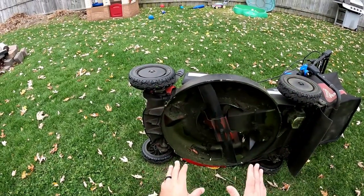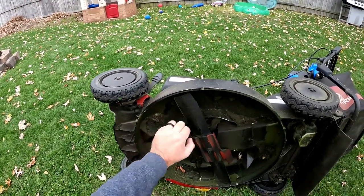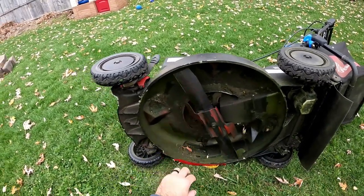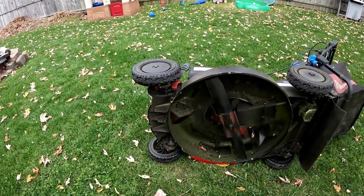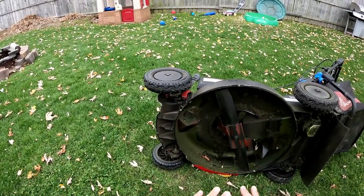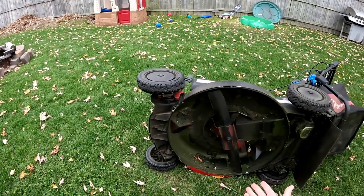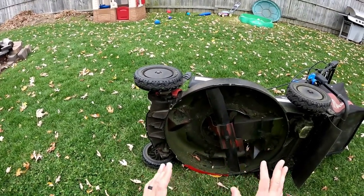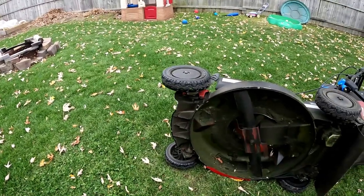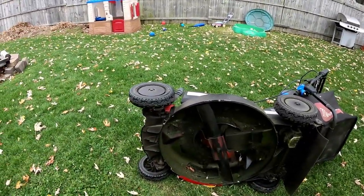This is the underside of the Toro Super Recycler, and I'll show you why it makes it such a great mulching mower. They have these two red knockouts right here on the underside, and a cover that goes over the top of the blade. Essentially what this does is keep the grass underneath the mower longer so the blade can work its way around and chop the grass into finer bits, leaving less in your lawn. This is what Toro is very known for — their mulching capability. I'm going to flip this back down, turn it on, and mulch up some of these leaves in my yard so you guys can see the results.